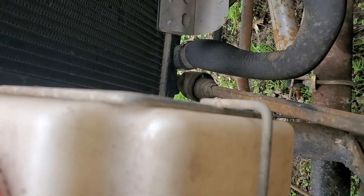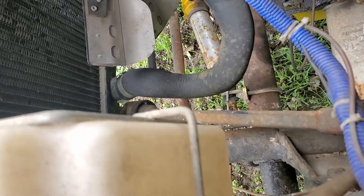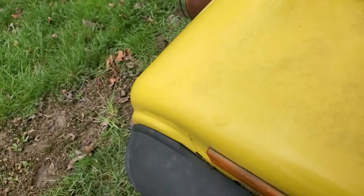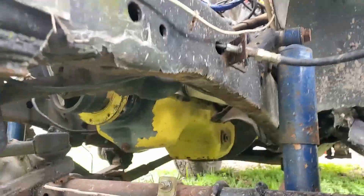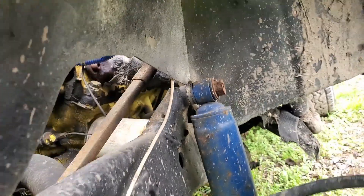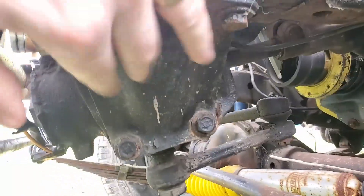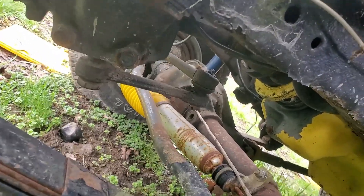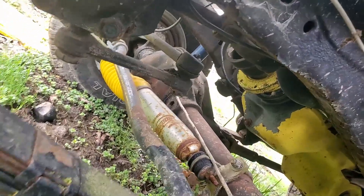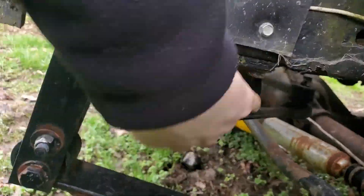Now we're going to rock it back and forth and go down in here. We can see that's rotating down in there. Now what is that supposed to move right after that? We'll come over here. Now we're going to look up in here — you've got your shaft running down, and right up in here we have our steering box. So we're inserted into our steering box and it rotates, but nothing else is rotating, which tells us that the issue is in the steering box.